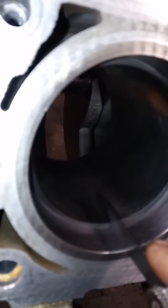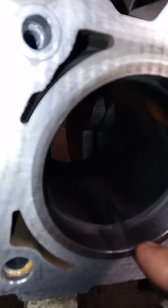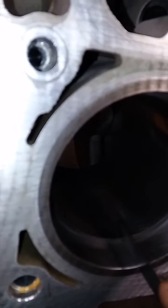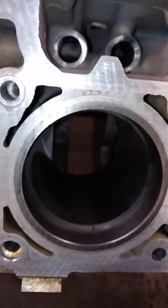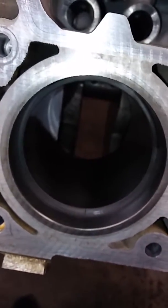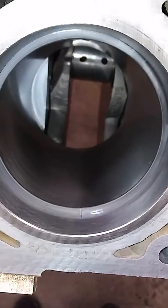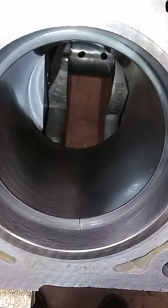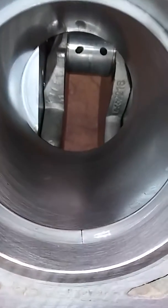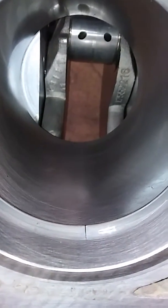And I don't know if you can see that. I can get the 14 in there really comfortably and slide it. And you just kind of go up until you get the maximum. The other one felt about 14, 15. 14's a little snug. 15 feels really good. You don't want them closed any more than that, because when they're tight, you can end up breaking a ring.